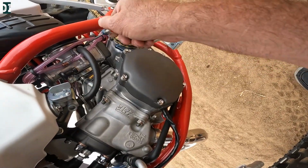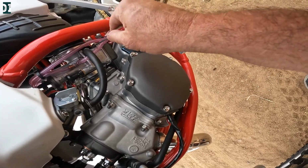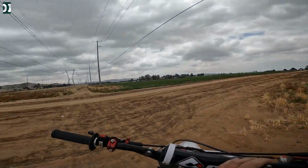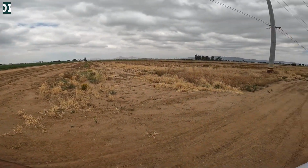I did play with the air screw a little bit. The bike runs really good, but it's still not 100%. I think we can still get a little bit better response on the throttle. It feels a little bit rich on the bottom, and we just feel that it can be a little bit more crisp. So we're gonna go back in the garage, we're gonna take the tank off, loosen the carburetor, flip it to the side,